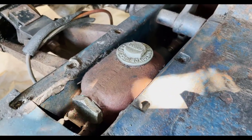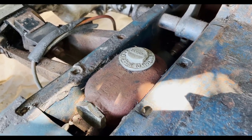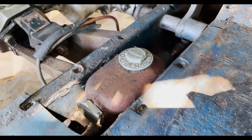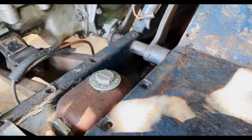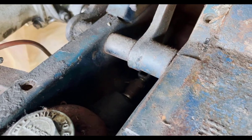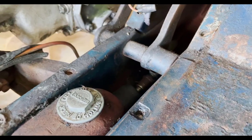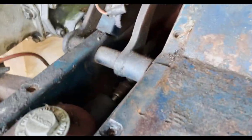There's our master cylinder. It looks a lot like the master cylinder in early post-war Bentleys and Rolls-Royces — Mark VIs, R-Types, and Silver Dawns. It also looks a lot like a Jeep master cylinder, but they're not quite the same, so you want to get the right one for your car. The way it works is really simple: the brake pedal pushes the rod into it directly. By putting it under the floor here, there's very little linkage between the pedal and the cylinder.